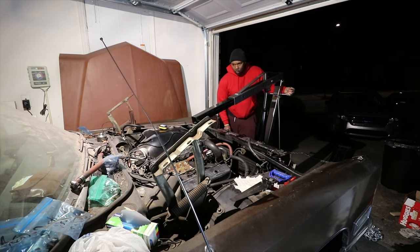Lifting real slow because the engine is still kind of glued to the transmission. I'm lifting and checking behind the transmission so I can maybe pry it a little apart. All the screws are out — it's just been together so long it's not fully separated. I don't want to break the transmission since I'm still going to use it, so I'm just lifting real slow and prying with my little pry bar, giving it some taps to kind of break it apart slowly.